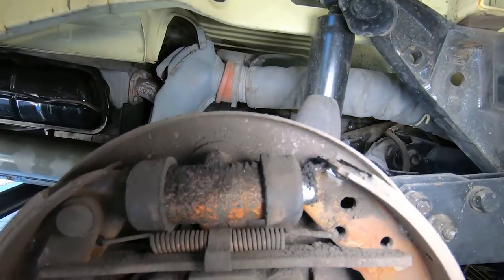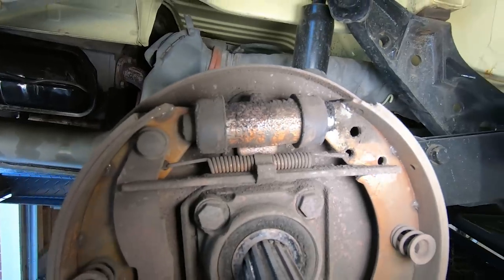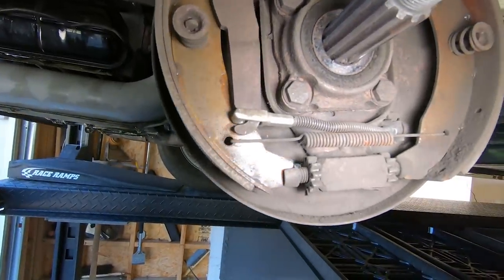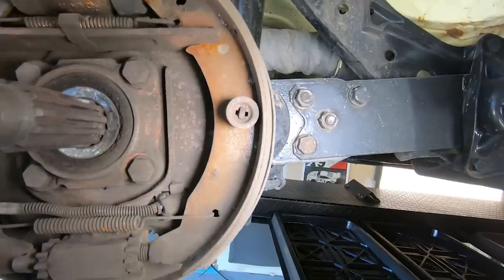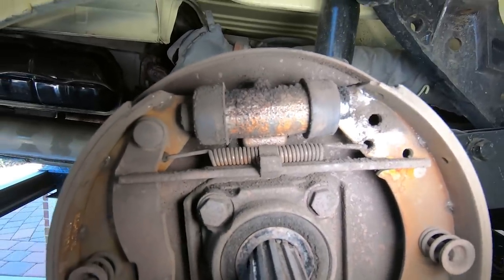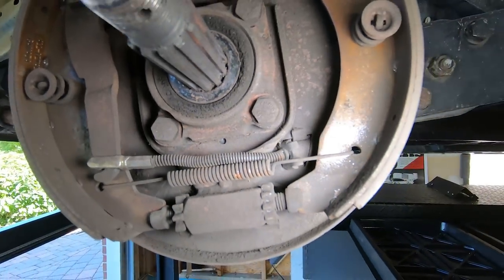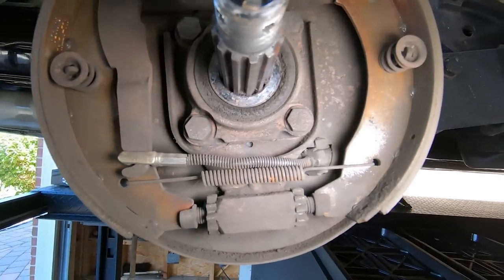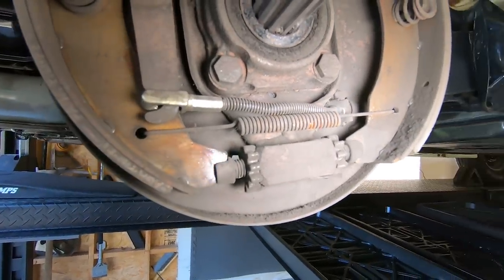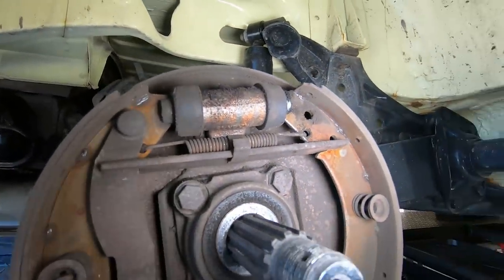We take a look at our brake cylinder up here. I do see a little bit of schmutz but I don't think it's actually leaking. The rest looks good. How do our pads look? They look very good as well — even thickness all the way around, which is a good sign they're in adjustment. The springs and clips look good. This little guy here is our parking brake cable — one attached, not broken. Looks like somebody's been in here working on these brakes not too long ago. The adjusters and spreader bar look like they're in good shape.